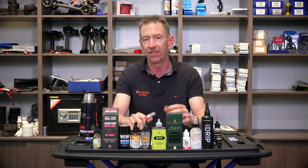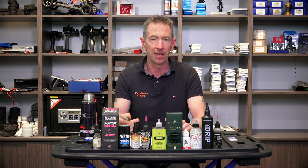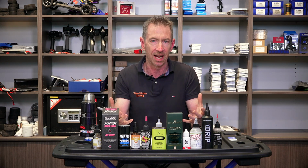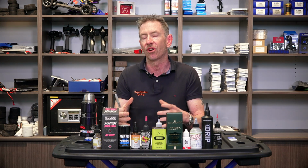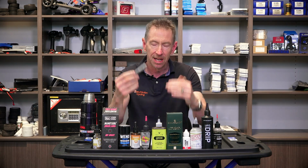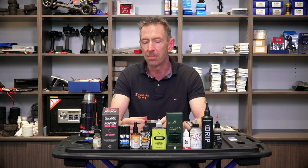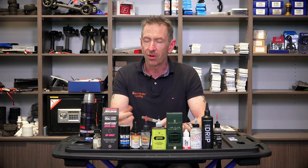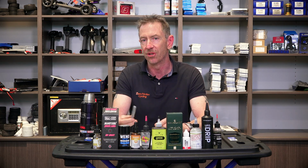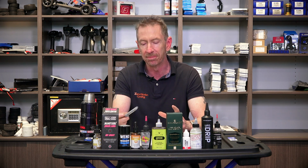And if they tested on a different day, in a different climate, the power meter is going to read a little bit differently. And when you've got a 5 watt variance from the gun, there's only so much stock you can place in it. So if they have this lubricant here and this lubricant here, maybe not. Maybe if they retested, it would switch. So just be aware of somebody trying to assess lubricants when you've got a 5 watt variance in your testing instrument to begin with. That can only go so far.